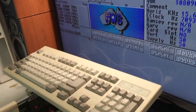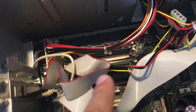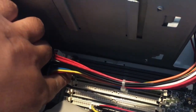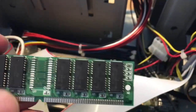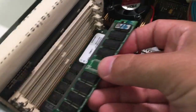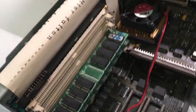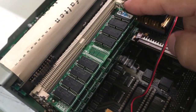Let's install some more RAM. RAM is really simple — you just buy an old PC for 50 bucks and you have got all the RAM you could dream about in there. We have got two RAM blocks. Let's check them out. Let's just push there and push there — there we go. This is 16 megabytes of RAM. Two 16 megabyte sticks of RAM that we're going to install in our Amiga 4000.